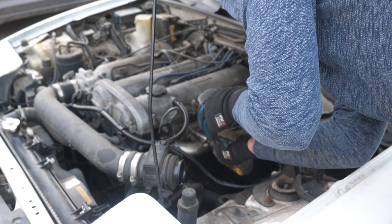Here it is - the cold side of the turbo. It's going to go down into the intercooler, then back up like this. The piping is relatively simple and straight, not many bends, and you can also do all of this without welding - it'll just take a lot more silicone couplers. In the next episode I'm going to work on the oil lines, getting the hot side of the turbo done, and mounting the Megasquirt. If you enjoyed the video leave a like and let me know what I can improve on.